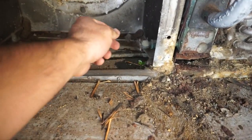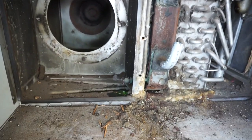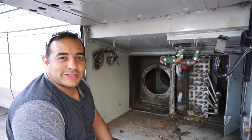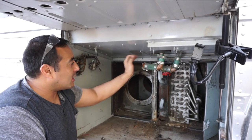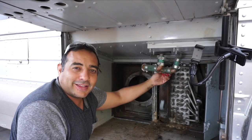when we turn this on, there is a fair amount of fluid coming out of there. So we're gonna try to drain this thing. I've got a pan under here catching it. There are shutoff valves similar to these in the back, up underneath the engine. I did turn those and they turned, they're all open. What this does is this loops and goes to the front, to the defroster for the front area. This valve is actually closed. I'm afraid to open it.